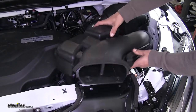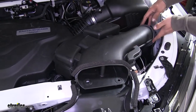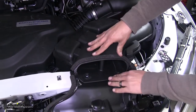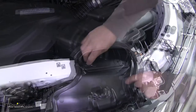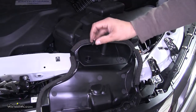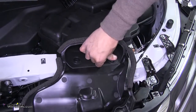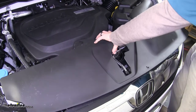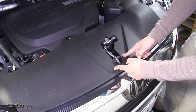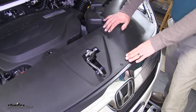Put the front section of our air box back in place. The easiest way to get it in is to get that rubber boot on first, work it back and forth until it pops in, and then it'll line up with the front just fine. Put our push pins back in place — on these, the screw section can just be put in and pushed down and it'll lock into place. Then put our radiator cover back on, making sure you get that latch between the right section. Once it's all lined up, go around pushing all the push pins back in place.